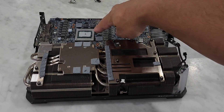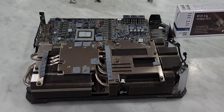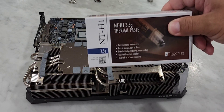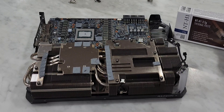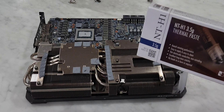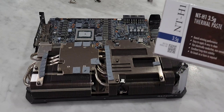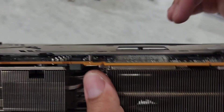After wiping off all the old thermal paste, I applied new paste. The method I use is spreading it around the whole chip and leaving a little dot in the middle so it spreads evenly — I get the best results with that. Today we're using Noctua's NT-H1. I've tried Thermal Grizzly, Gelid, and Arctic in the past. Now I'm going for longevity rather than peak performance because I'm tired of taking this card apart. It's fairly cheap and you get a decent amount in the tube.